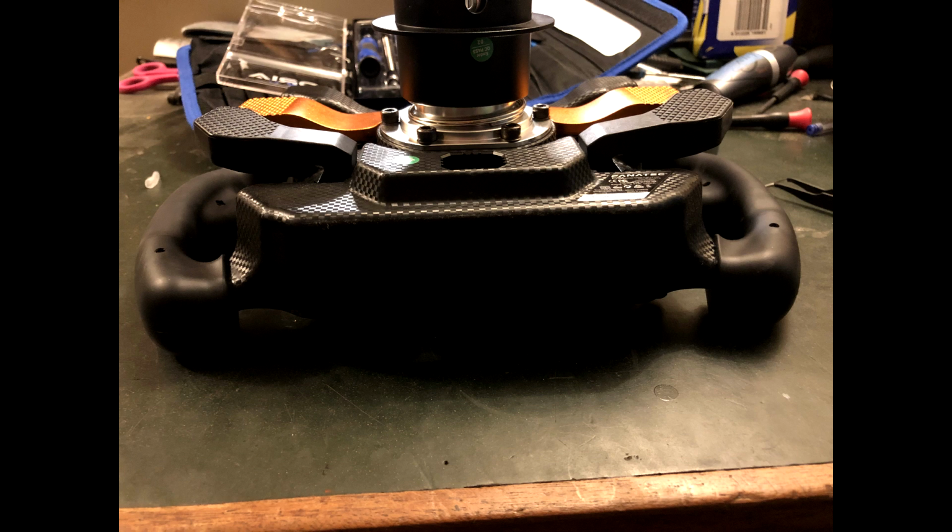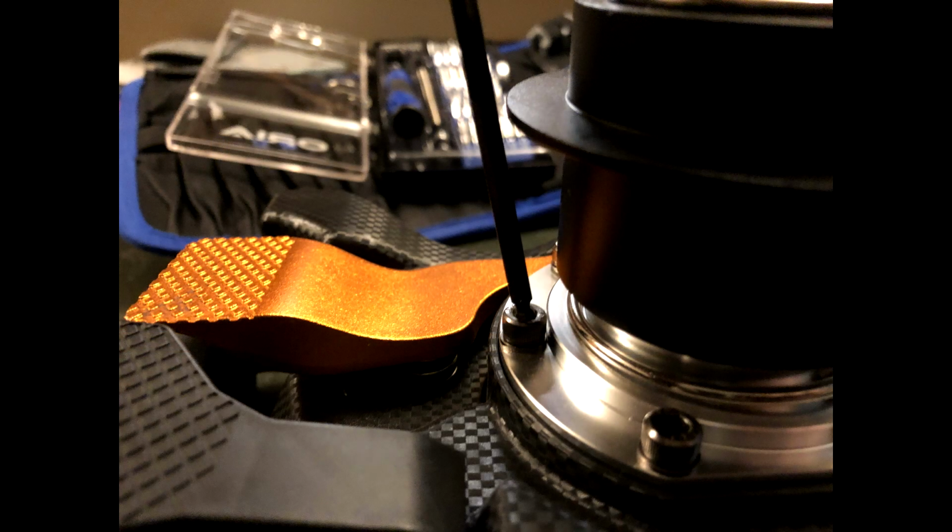At this point you can turn the wheel over. The grips will keep the front stuff clear of the desk where you're working. It's possible you could remove the loom the rest of the way without removing the quick release, or the original horrible mount, but it would be a ball ache to do, so it's worth taking 2 minutes to pop the QR off. With a ball-headed Allen key it's easy to do around the collar, just undo the 6 bolts.